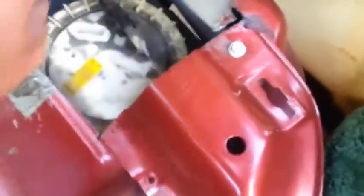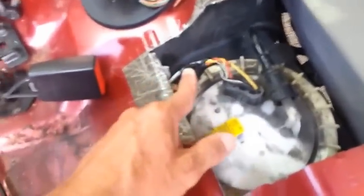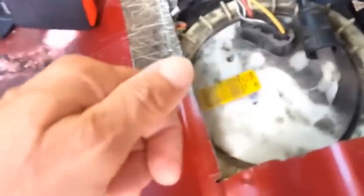I didn't think I had any room left to use my Dremel tool to go down, but I had more room than I thought. The only thing I had to worry about was the plug, the wire, and you don't have to worry about that until you get roughly about this far in. I nicked it a little, just barely, so I went ahead and taped the wire. I didn't cut through or anything like that. Not only that, you can set the depth of the bit as far as you want, basically. You're not going to hit anything until you get way down here. When you get down here, that's when you really got to watch the depth of the drill bit. So what I did is I took my depth gauge off of the Dremel and did it by hand.